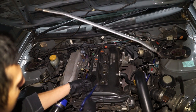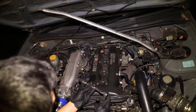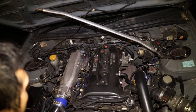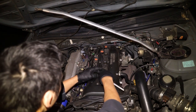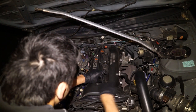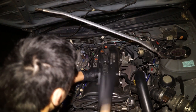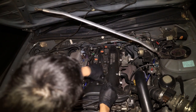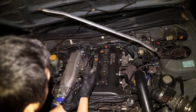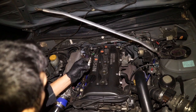If you don't have a proper car socket set, you'll need to put a little rubber insert in the socket tool — I've got a bit of my rubber glove in there. I've got all the extenders on there as well. I'm going to untorque the actual spark plug, loosen it up a bit, and then hand loosen it. Just go through this until you're absolutely 100% sure it's out of the thread, then take it out very, very softly. It should be stuck in the tool because of that rubber insert. So that's your spark plug.